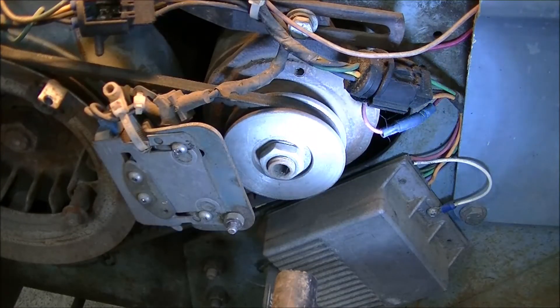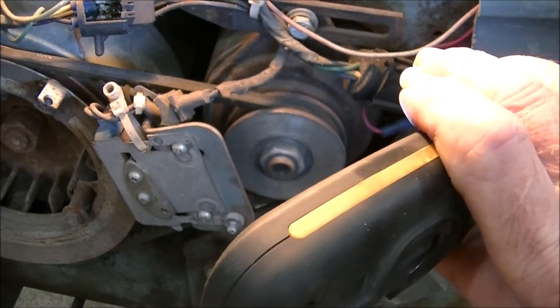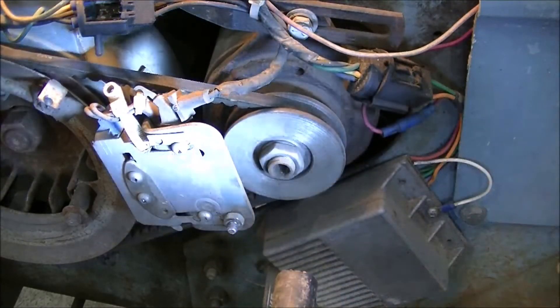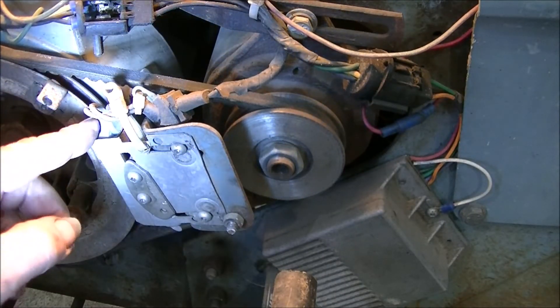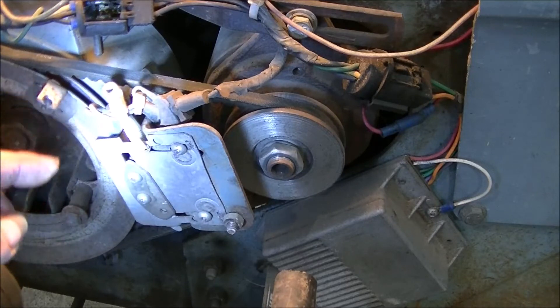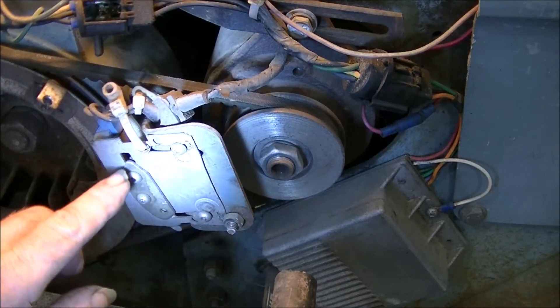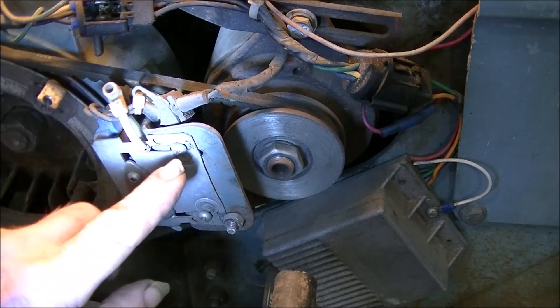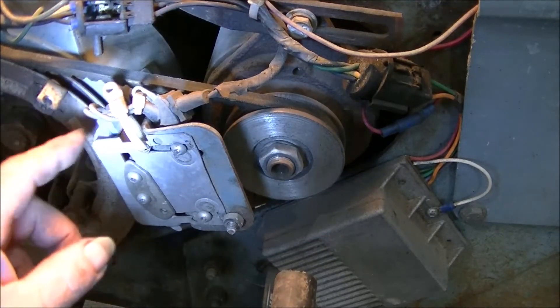Out of camera view up here — I'll twist the camera on it after — it's just a regular Ford coil off one of those applications. I got it out of the distributor, kept a little pickup in there, and made a kind of a butcher-job bracket so I could set the timing and set the air gap by moving this blue pickup back and forth.